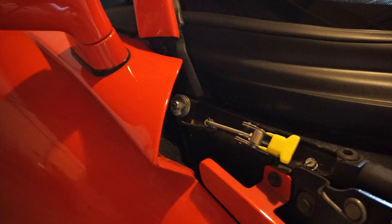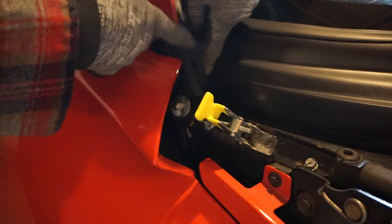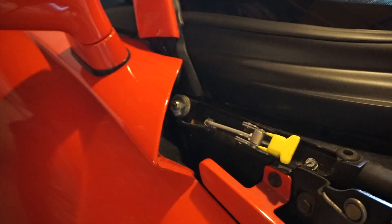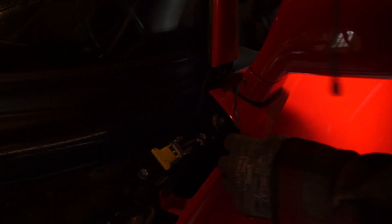Alright, this side's all set now. These things are a little tricky, but basically here's what you do: you take one end of those hook wire things and hook it to the roof. Then there's a little roller here that you wrap it around. Then you feed it towards this torque hook lever thing. You get them to hook like so, then start to pull this one back, catch it, and then you torque it down like that. It really pulls the roof into place. It's actually a pretty cool little design. It's just there's some awkwardness to it since the Viper was never really meant to have a roof like this — this is kind of a retrofit deal. So because I didn't get a good shot of the other one, I'll show you on this one more.